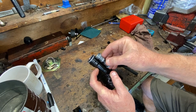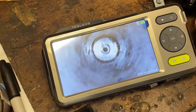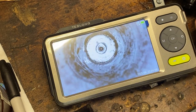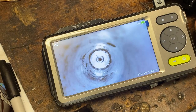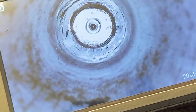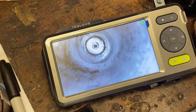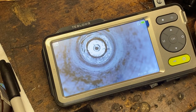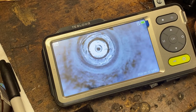When we see the inside of this bore you'll get an idea of the problem. You can see line-like grooves eroded into it — there are some serious corrosion issues, and one really bad one is right in that area, about the same location as where that piston's rubber seal sits in the relaxed position. That probably explains why it doesn't fail when you put pressure on it — because it moves into a cleaner area of the bore.